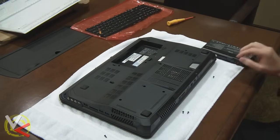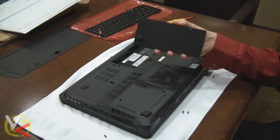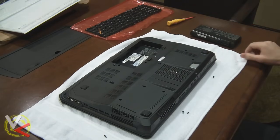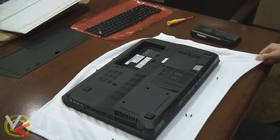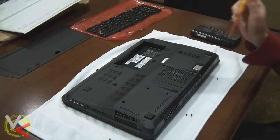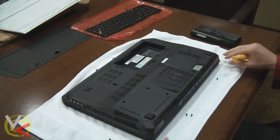To change the keyboard, what we've got to do is start at the bottom. Go ahead and take out your battery first because you don't want any power going to the unit — that might cause problems if you do a short or something to your system. I used a number zero screwdriver, but you might get away with other sizes.